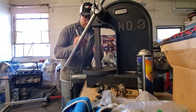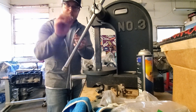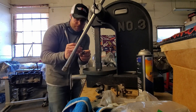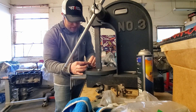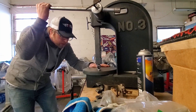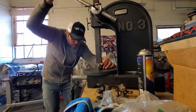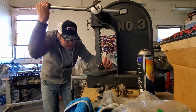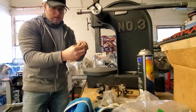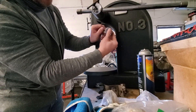So I gotta press in two of the bearings on this guy on the arbor press. Just make sure that the lettering is out — when I say out, make sure it's facing outward on this rocker arm. Simply verify it, set it on there, make sure it's somewhat square, then bring your arbor press up and press down all the way in. Square it up. Press it in. There we go — it's flush on this side, and flush on this side too. And that's it.